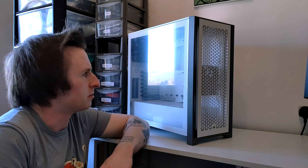We've got the bulk of everything installed now — the motherboard is in. I thought the gap was going to be more irritating, but it doesn't actually look too bad. Obviously a full-size ATX board would have been better, but it looks good. We've got our three fans in front for intake and two exhausts. Next we need to start getting all the connectors plugged in. I'll get the smaller, more finicky ones done first before we move on to the power supply. One thing to note is what connectors we have available — this motherboard is the B450 Mortar Max, which unfortunately doesn't have a USB 3.2 Gen 2 connector, so Andrew won't be able to use the front panel USB-C. He's still got a USB-C port on the rear of the motherboard, and when he upgrades his platform later he should be able to use it.